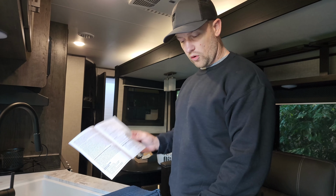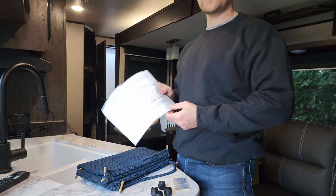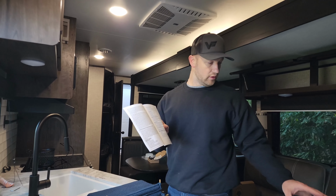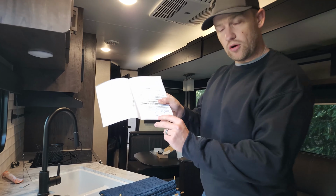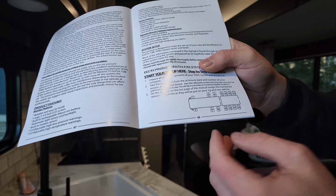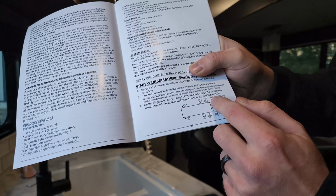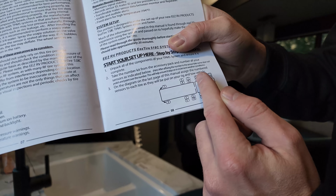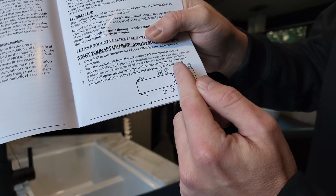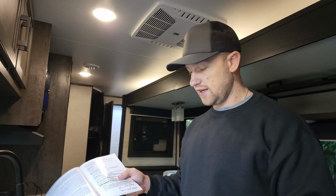Okay, so we are going to label these sensors, and this is very important because when we are setting up the screen, the electronic device, it is going to go through each axle when you are setting up the high and low pressure. So I actually made a mistake. I labeled my two axles T1 and T2, but when you're going through the settings, it's going to get to that axle and treat those two the same, and I want them different. They'll actually be the same setting, but for your trailer, maybe the two tires have a different PSI rating. For ours, it's both 65 PSI. That's the starting PSI that we're going to be working on. We're going to just use this.